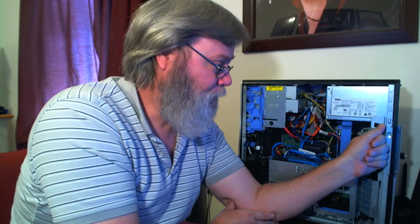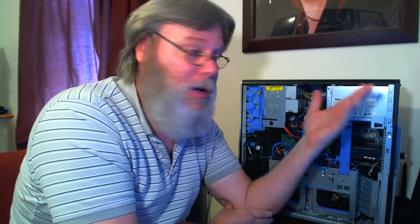So make sure your cover is closed up good. Now, you can turn that intrusion switch off in BIOS. What you do is turn your machine on, hold the button, then release it. Or, if your machine is on and you open the case, the fan should start revving up when that button isn't pressed in — that's how you test if the button is working. But if you want to turn it off because your button is defective, you can go into BIOS and disable it.